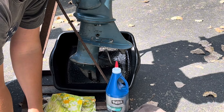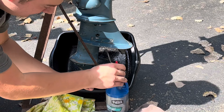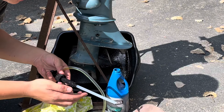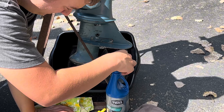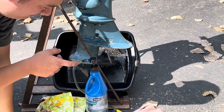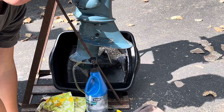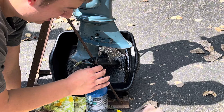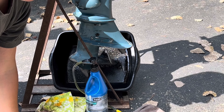Now you may start to prepare your gear lube and fill pump while you're letting the oil drain. Go ahead and take this cap off and insert your fill pump. Make sure your tube on the bottom is inserted so that way you can draw oil from the bottom of the container. One thing I noticed when installing this fill pump onto my gear lube container — it doesn't quite screw on there. You gotta love good old Walmart engineering; they didn't design their own brand fill pump to fit onto the bottle. I just have it set on there, but I'm sure with a name brand gear lube oil container it'd probably screw on with no issues.